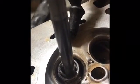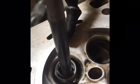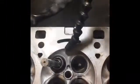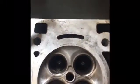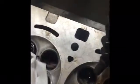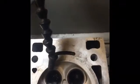And with that being cooled and lubricated, we'll go ahead and grind that surface just to the point where it's cleaned up. We really don't want to take much more off than we need. One crucial step that I forgot that can really help us make sure that we are taking off the right amount of material. For us, our width on our 45 degree angle is 55 thousandths to 71 thousandths. So with our digital caliper, we have an idea of what that looks like.